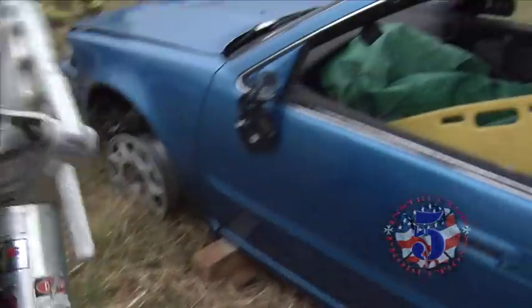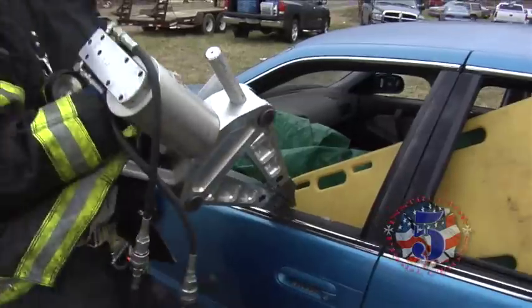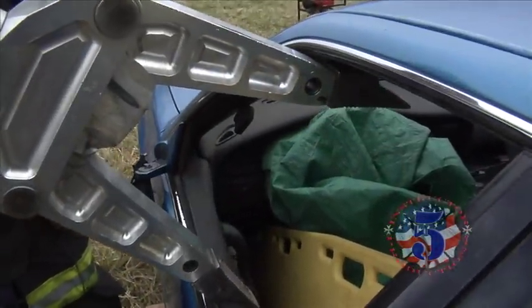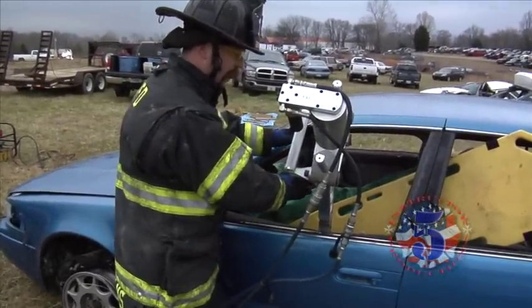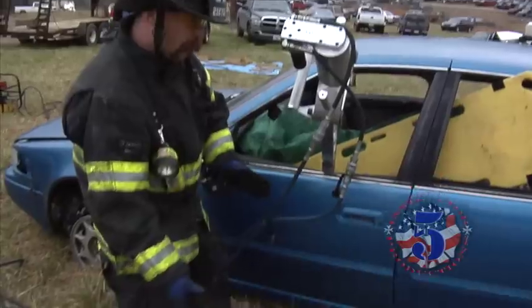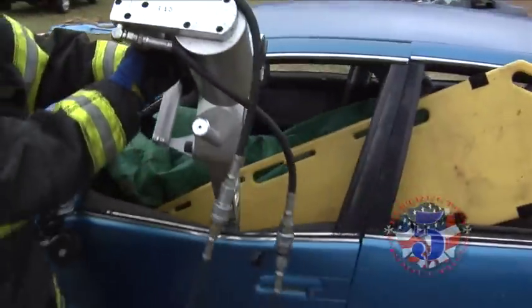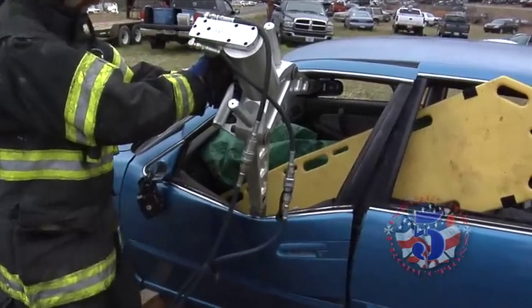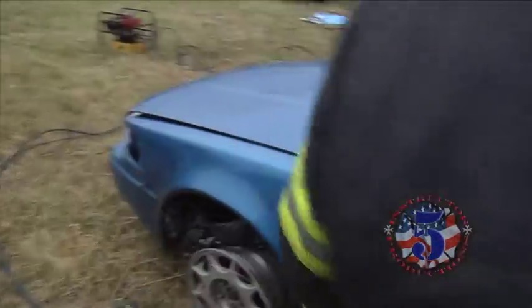I'm going to show you one more technique with the hydraulics. We like to call it the vertical crush. It is awesome if you have a side impact collision or you need something to pull the door away from the patient. We like to put it just about like this and get it in position. You can see that the tool is holding its own weight — look at the position of the arms. What this is going to allow us to do is push this door out and away from the patient, and it's going to gap open on both sides — the hinged side and the nader side. So we got a pretty good gap here if we needed one, and we got one going on up front as well.